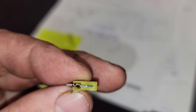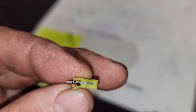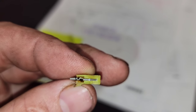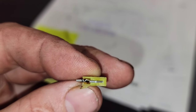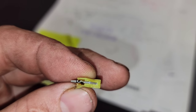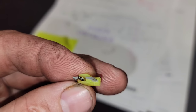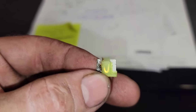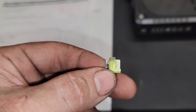So I think it's a combination of two things. It's still starting with this fuse, but I'm pretty sure there's something wrong with the purge valve in the vehicle as well. And it's just two 8-millimeter screws that you pop that purge valve out on the top of the motor, put a new one in, plug it back in, clear codes, and you're fine. But that sucked-in gas tank is a good indication of it, unless they hit something. But this is the main problem here. This is the code that's set on the computer for the fuel pump driver module fuse.